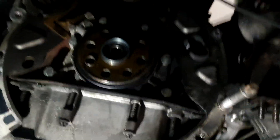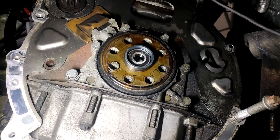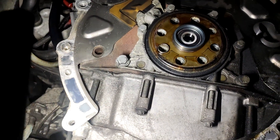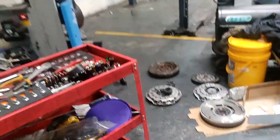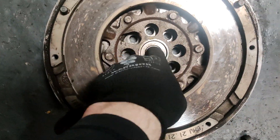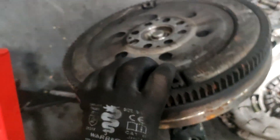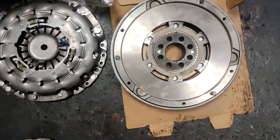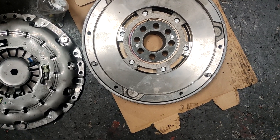Because the flywheel is different and there's no bearing in the flywheel, you have to put the bearing into the crank. There's no specific measurement for this, but you can see how far the bearing is recessed in — as long as it's recessed in a little bit, it's fine. In the old flywheel the bearing had a cap in the bottom; that's what usually goes into the crankshaft on the original flywheel. But because we're putting this one in, you have to put the bearing in there. That's the pilot bearing for the gearbox shaft.